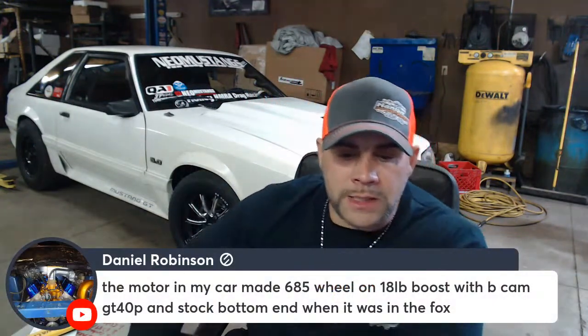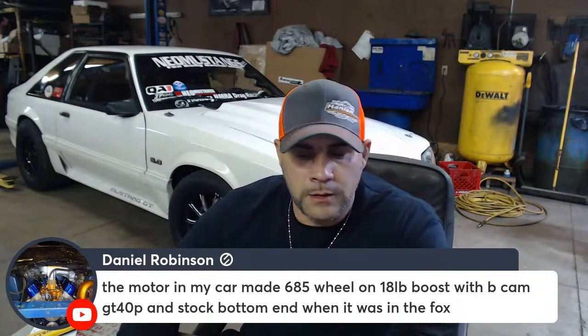The motor in the car made 685 on 18 pounds of boost with the cam. And let me tell you what, if you can achieve 500 wheel power in your Foxbody, that's a great number to shoot for if you're looking to make more power. You could make almost 500 on a stock rebuild with E7 heads, a good turbo setup and a good tune. We did it on Project Hot Wheels. We made 478, almost 500 wheel on a Mustang dyno. We ran 1090s and the car was like 3,400 pounds. It was huge. So it's out there, guys.